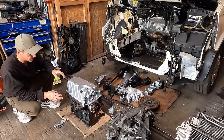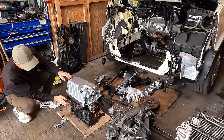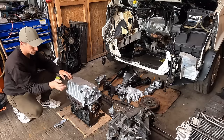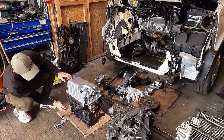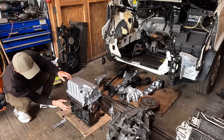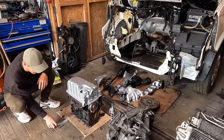On the T5, that's fine. On the PD130, which is from a car, ASZ engine code, there's a couple of these that aren't used in the Skoda. So before we start bolting any engine mounts to it, the corresponding bolt holes on the Skoda engine aren't used. They are there and the threads are there, but they haven't been used, so they're a little bit corroded. So we've got an M10 tap and an M8 tap.